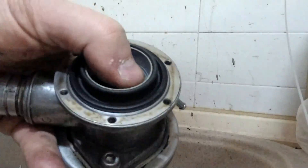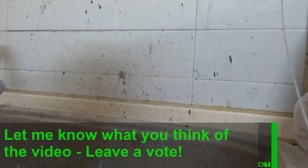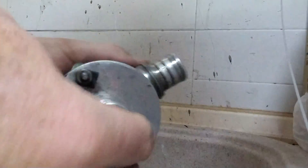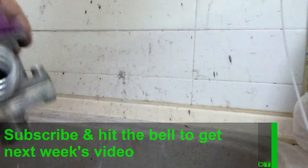On top of the spring we've got this plate which adjusts the tension up and down. We've got these two springs which are both inside this ring, just sitting there like so, and then we have the diaphragm around the outside. I'm going around checking it and it looks fine. So I'm going to reassemble it with just the big spring, not very tight at all. That seems quite a bit easier to push in now without that second spring, and I can even by putting a vacuum on this with my mouth actually lift it. I'm going to give it a bit of silicone spray lubrication.